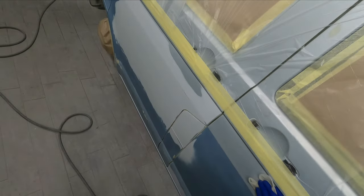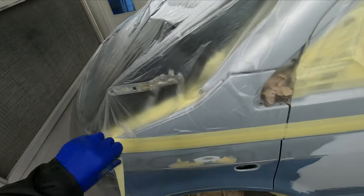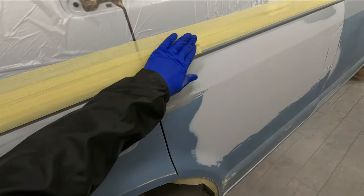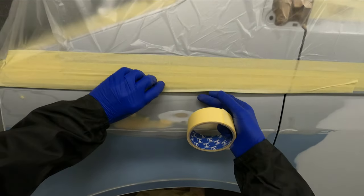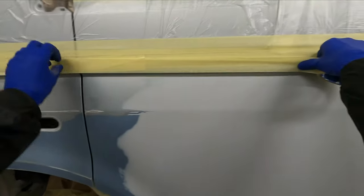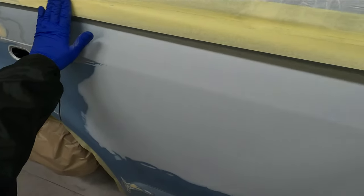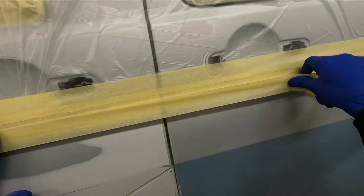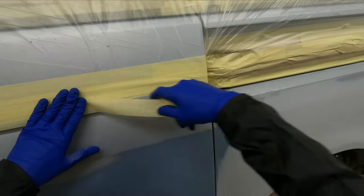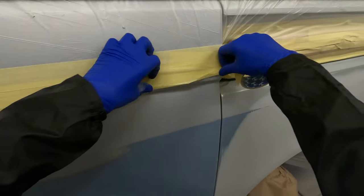Because we don't want a hard line there when we're finished painting this bottom edge — I want a little bit of a feathered edge that can easily sand out before we come round to painting the top side. The way I'm going to do this is just by laying a piece of tape with about a half inch overlap over the edge. That will give me just enough overlap to get the paint underneath. If I just lightly fold it over, that's going to give a feathered edge that when this is done and we're fine lined off the bottom end, I can just lightly sand off. It's also a very cheap cost effective way of masking this top end off.